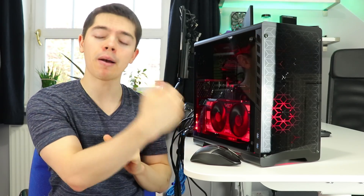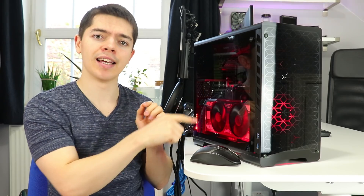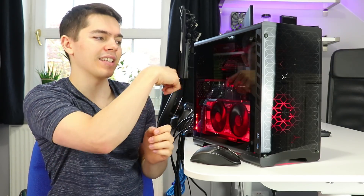You wouldn't have enough space to do your build without having cables strewn in the main compartment without going back behind the motherboard tray. Cable management space really should be increased. The segment at the top for folding cables is nice but isn't always useful when you need to dress cables down the side to reach the graphics card.